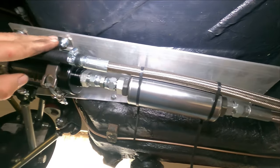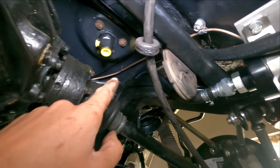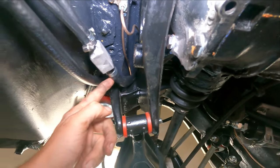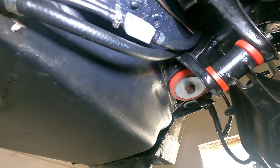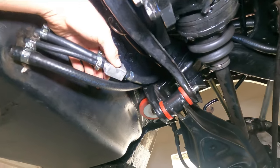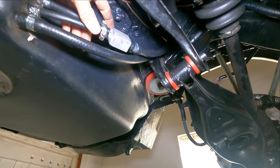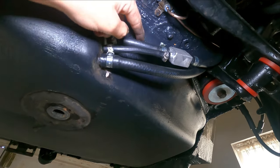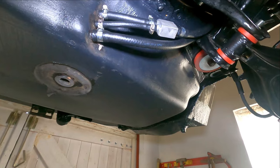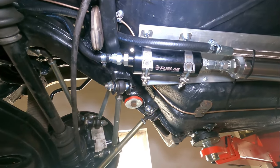The line will be supported on here - it is going over the subframe completely. In here you have the feed line and this is the return. I want to make a support for the block first. This is aluminium so it weighs nothing and has enough support. About the hoses: it is a 12 millimeter fuel line in the return and in the feed. In the return, after this it is a 10 millimeter and a 6 millimeter, so that is good enough to have enough return flow if needed. Like I said, this fuel pump is supposed to be pulse-width modulated, so it should not be a problem to handle that.